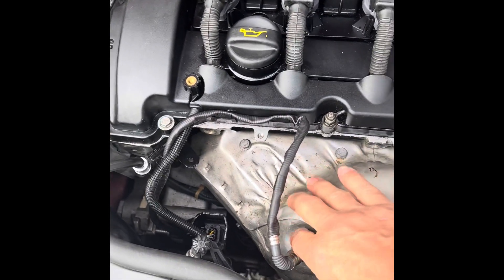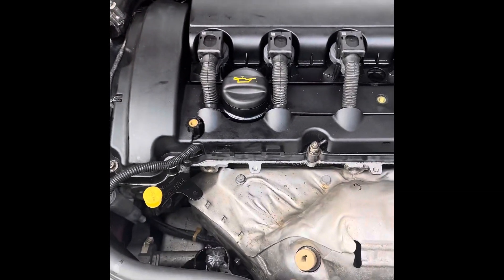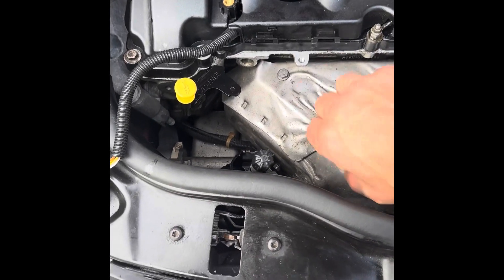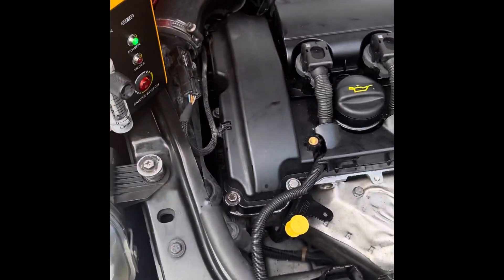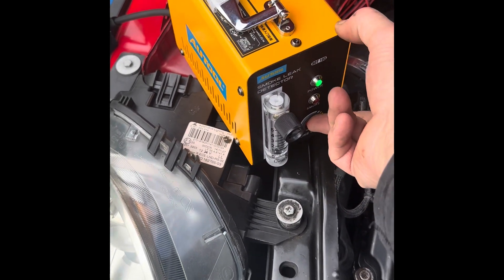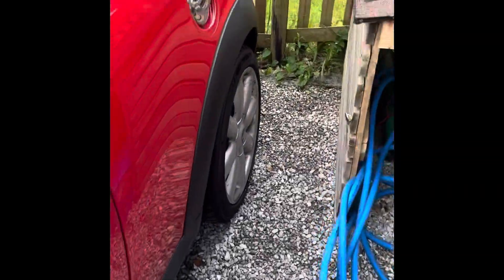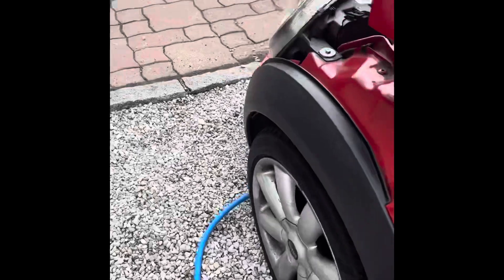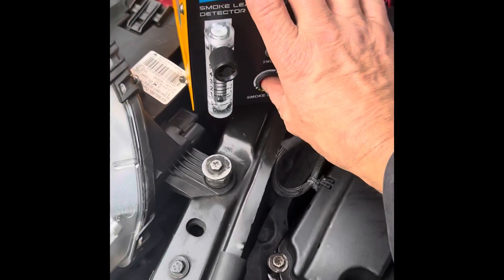Next one to do is the O2 sensor area. We're going to smoke test the exhaust on this Mini N14. I've made a little plug — basically a cut-down plastic coupler with a hole in it. Got our smoke machine — that one goes in there and it's all sealed up. Thanks to Mike, we've put a couple of rubber gloves over the back of the exhaust, so the plan is to smoke test and see if there's any smoke coming out underneath.